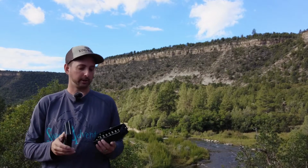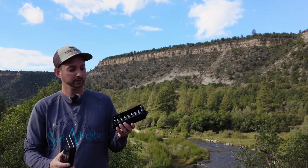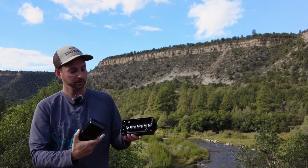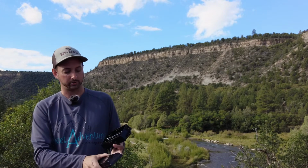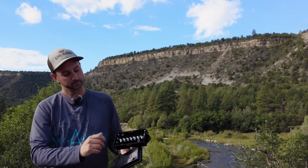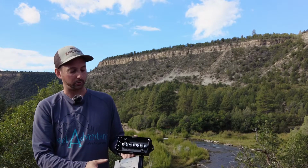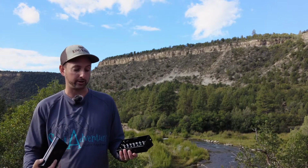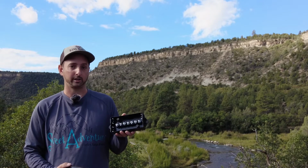Alright, I personally plan to upgrade my junction box to this. It comes with a nice cover. As you can see, it's got the terminals for the ring connectors. I'm planning to crimp ring terminals onto the wires and just tighten them down. And that way you can see where the good connections are and where they aren't. My issue wasn't actually in this spot, so I haven't done it yet, but you may want to consider doing that if your issue is here.